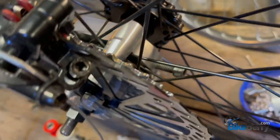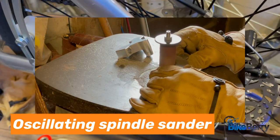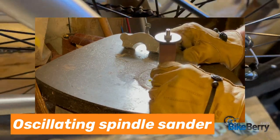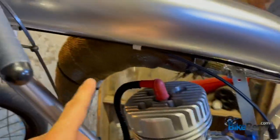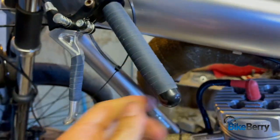So I had to modify an adapter to fit on here. It was a one-inch adapter and what I had to do was shave it, make it an inch and a quarter basically. So that's that on there — it's just bolted on there right now. I want a chain tensioner that's going to help go through all these sprockets. I got a silencer on the other side, a good expansion chamber. It's ready to roll. I did some tape kind of grips and everything. I'm super excited to get this rolling.